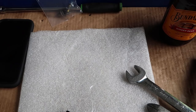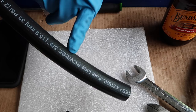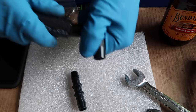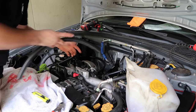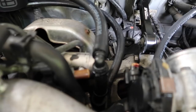Next up, locate the 5A fuel hose — it's labeled 'fuel line' on the packaging. Cut a three-inch section of this and take the corresponding 5A barb nipple 90-degree fitting, slide that on one side, then take a zip tie and secure the hose — make sure it's nice and flush so you don't slice your arm open. Take this end and put it on that end. Then take the 5A fuel hose they supplied and go from this port to the bottom port down here — trim your excess. If you have a passenger side intercooler bracket it goes through it; if not, just follow it on over, trim it to length, go on the bottom port, and secure it with zip ties.